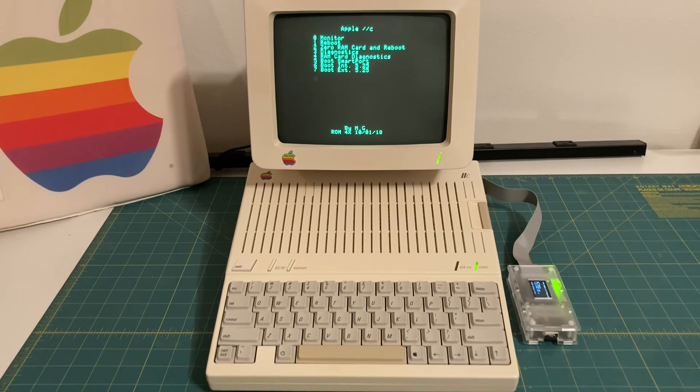Right now, we're currently using the IIc green screen monitor on the stand, and I've got my floppy emu hooked up as well — I'll put a link to that in the video description below. Basically, the TangyPak allows you to get VGA and HDMI — basically DVI video — out of the IIc. It's only for US NTSC at the moment, and Laser 128 support was added with firmware version 1.10, which is currently out. The TangyPak plugs into the video expansion port of the Apple IIc or IIc Plus and is powered from the port itself. It's a scan doubling device that will take the 560 by 192 video of the Apple IIc and upscale it to 640 by 480 — basically 720 by 480 at a 28.63 MHz pixel rate — a video resolution supported by most modern video monitors.